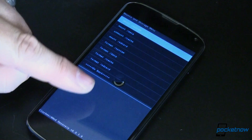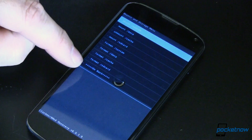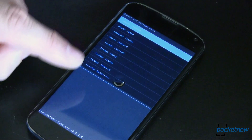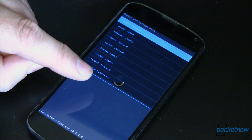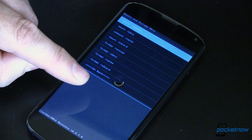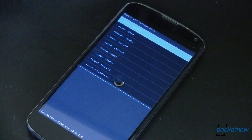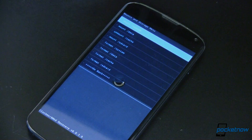Let's get down to flashing. First up, you're going to need a rooted phone — this does require root. I have rooted this and I'm booted up into recovery mode. You're going to need one of two different zip files to flash: new firmware for your radio. There are two versions — the .27-84 hybrid and the .33-84 hybrid. Either one worked for me, but the .33 worked better, so try them both and see which performs better.